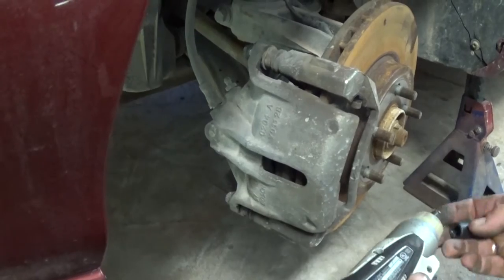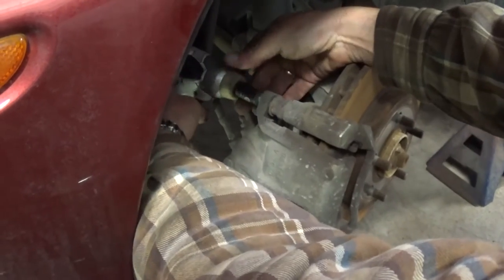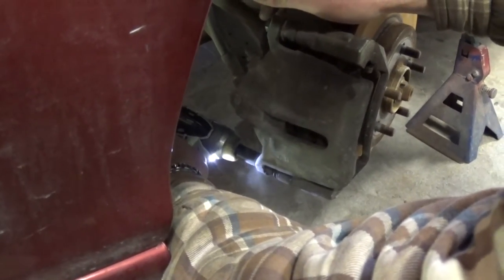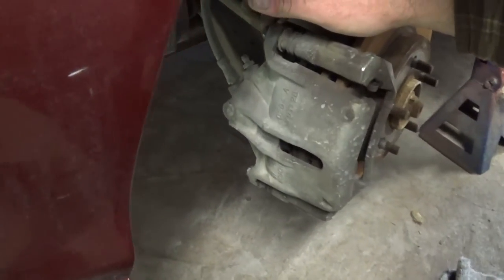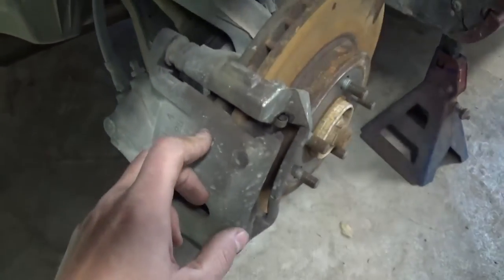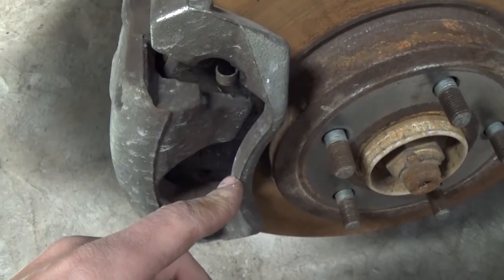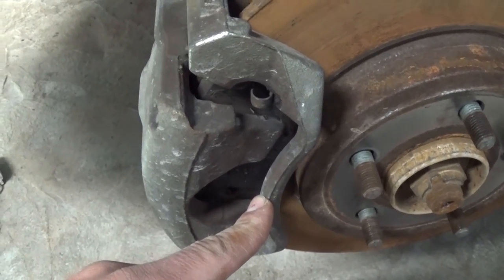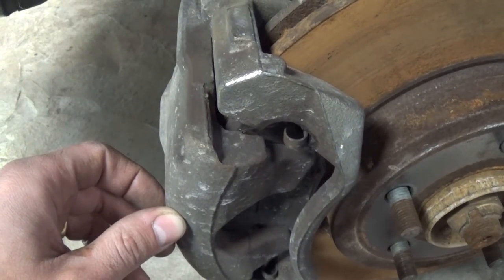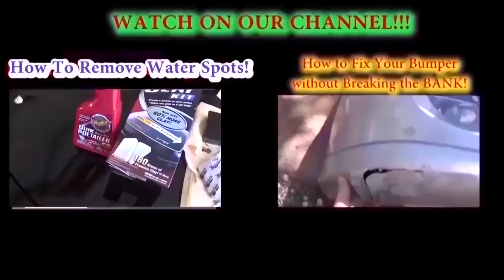Get those two bolts tight now — the two bolts that hold the caliper to the hub bracket right there. Now you need to go inside the vehicle. As you can see how much play we have right here. What you need to do is hit the brakes, pump the brakes a few times until you have no play. Because if you don't do that, when you start the car and put it in drive, you won't have brakes for the first few times. You can see how it's compressing now — go all the way until it's contacting. Make sure that it's holding. That's the whole procedure, guys.